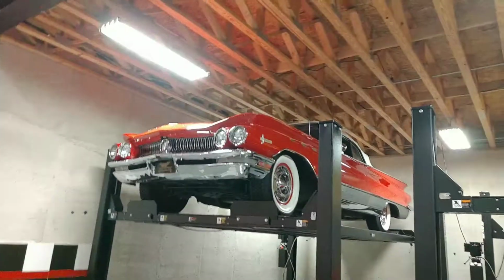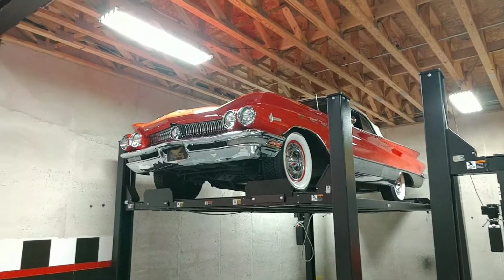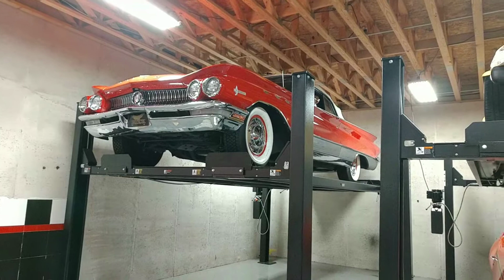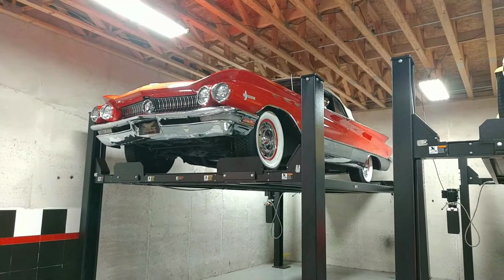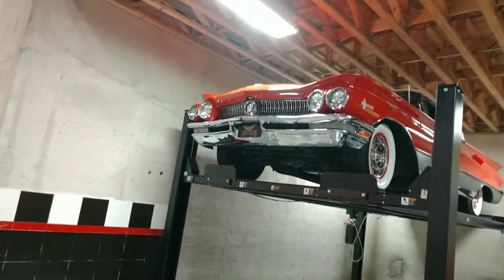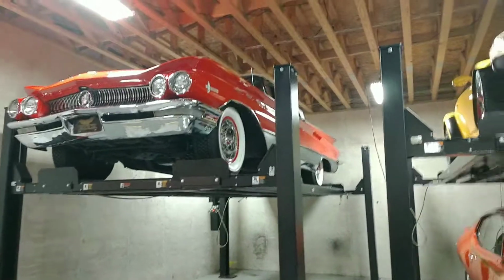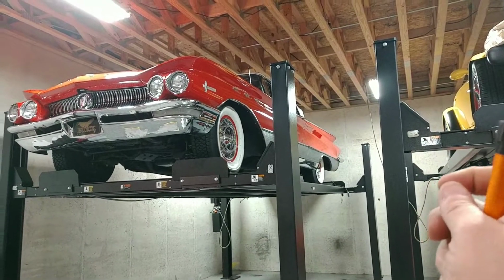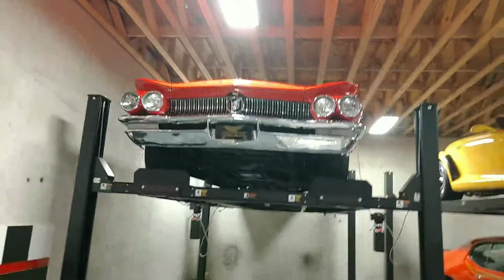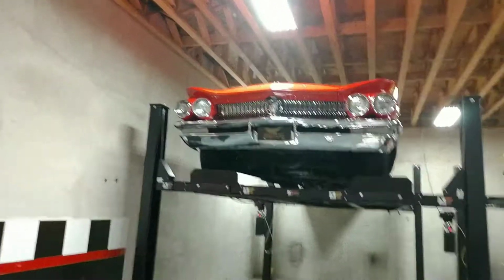So let's see, the overall assessment of the underside: very original. A lot of what appears to be older factory undercoating, or undercoated after the fact. So what we've got is an engine out, interior out, maybe not frame off, body on type restoration. Really well done though. And vehicle undercoated, one or two little, I'm not gonna say soft areas, but a few areas where there's a little bit of minor rot, and that is driver's side, rear passenger seat area, and then maybe the passenger side rear, in front of the rear wheel body mount area had a little decay, okay? Overall, I think very solid.